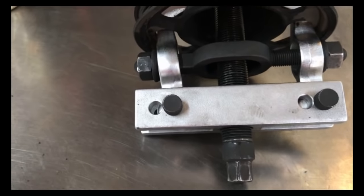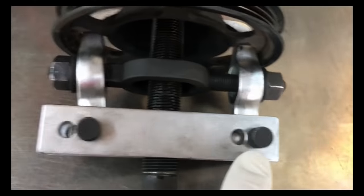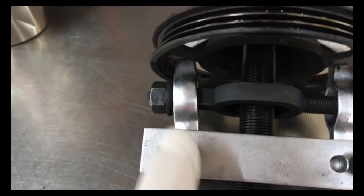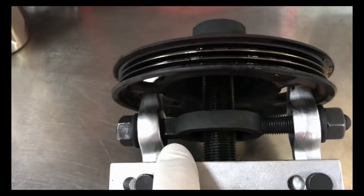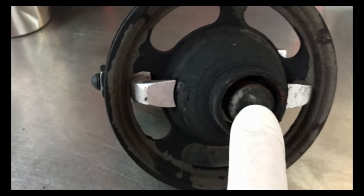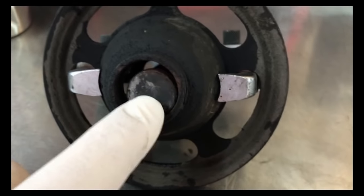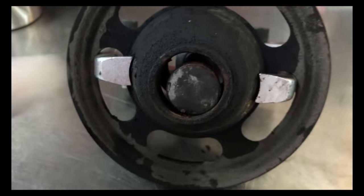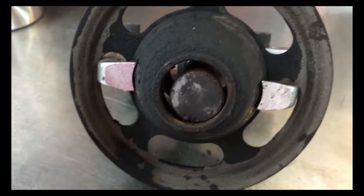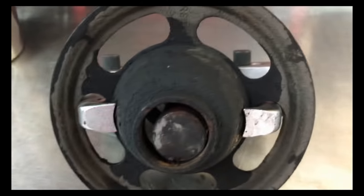Here's a better look at how I got the pulley on the puller. As you see, I had to put one of the pins on the outside and one of the pins on the inside. I used my crossbar and tightened up the two nuts so it would grab here. Then I had to put my flat tip on — it's not centered, but actually that was good because it grabbed on the outer lip. It didn't do any damage to the camshaft and it came right back off. And it looks like I'm going to be able to use my power steering puller to put everything back together.